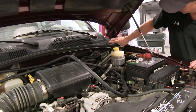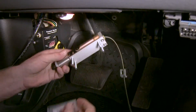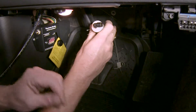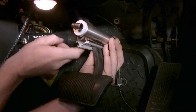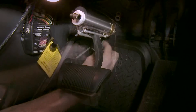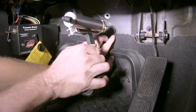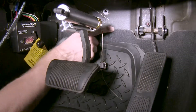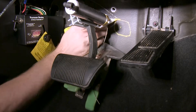Now we'll work with the other end of our airline tubing, which will go to our actuator. Here's our actuator - we're going to mount this to our brake pedal arm right here. This piece will clamp it into place. We want to make sure the cable end is going towards the firewall. We'll loosely install it for now just enough to hold its place. We want this cable to go in pretty much a straight line back towards the firewall. Push the brake pedal a couple of times to see how the cylinder will move - it'll start at a slight angle but as it pulls it'll go straight. Make a mark on the insulation and cut it out until we get down to some sheet metal.